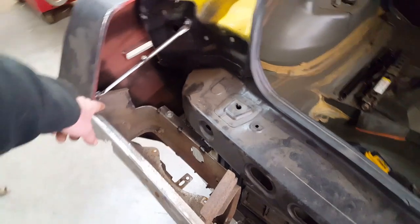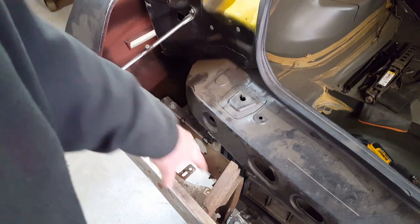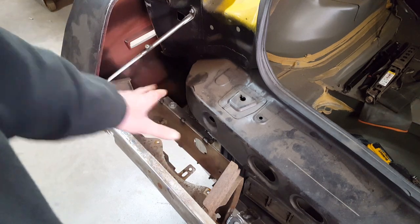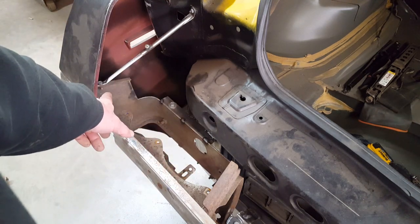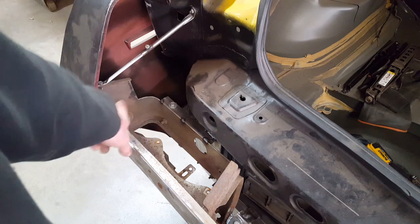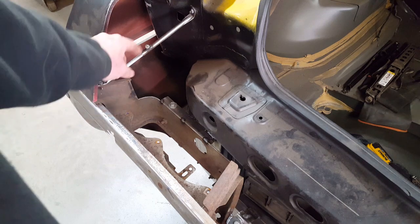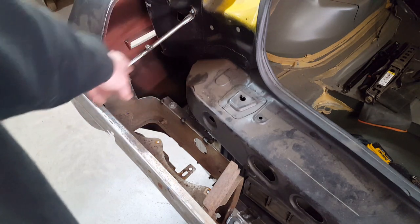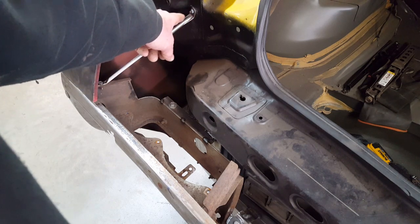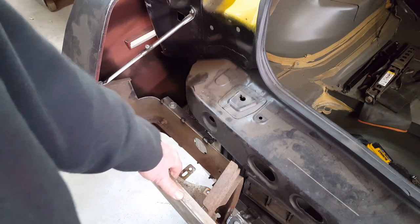Also in this area over here, I've taken my diagonal and I've moved it out away. It was originally bolted through this point here, but these are actually the points that you put the taillight housing to. This one here and here and here are all screw locations. So this is the very end of this inner bracket, and right now I have an adjustable rod on there so that I was able to rotate this up to the exact height that I wanted and tighten that nut down. That's good, and I'll replace that with a stationary rod without an adjuster, and it bolts up to an existing stud that's sticking out of the Challenger here, and then it goes down here, and that stabilizes the whole bumper structure. So it's pretty good.